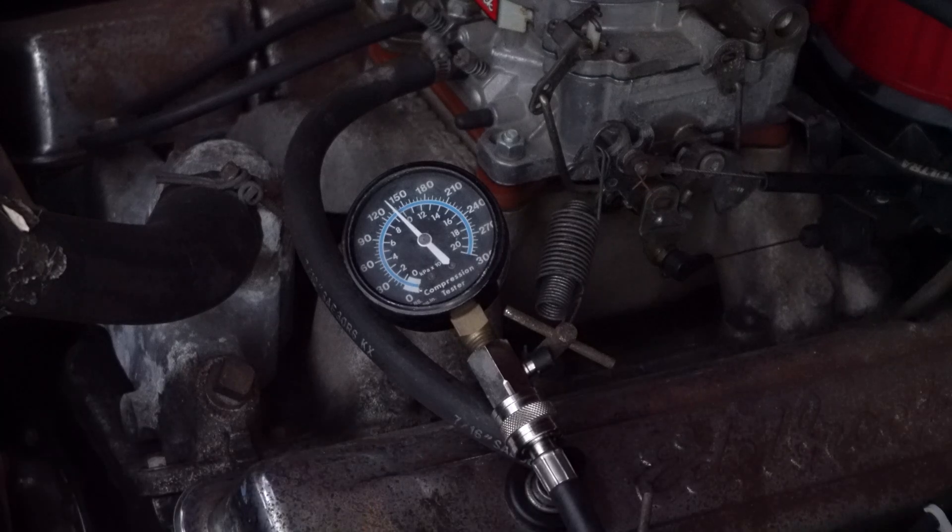So what I'm deducing from all this — let me know in the comments what you think — since the working cylinder is super fouled and the not-working cylinder isn't fouled, I'm thinking it's something with the intake valve. I think I either have a stuck lifter, a rocker arm that came off — which didn't make that much noise — or the valve lash is off, or the retaining nut backed off. Something like that. So next video we'll be peeling off these valve covers and I guess doing a tune-up. Make sure y'all tune in. Please subscribe if you like these kinds of projects — it really helps me out a lot and gets these videos in front of more people.